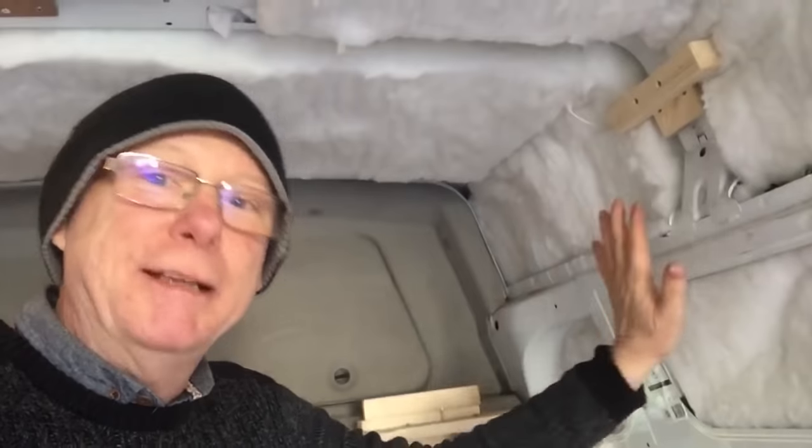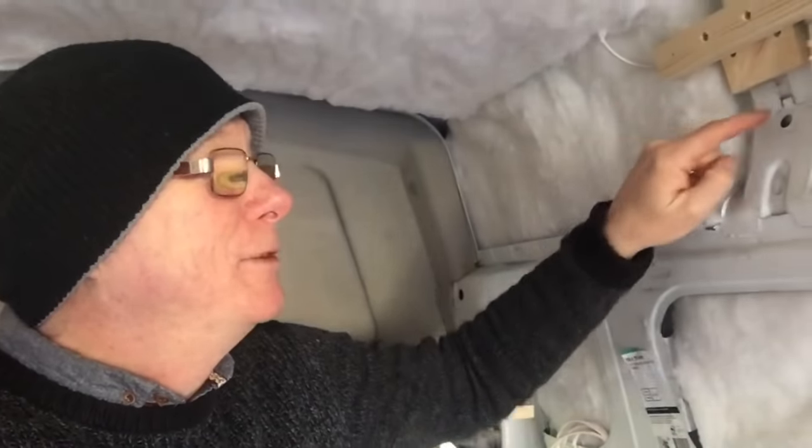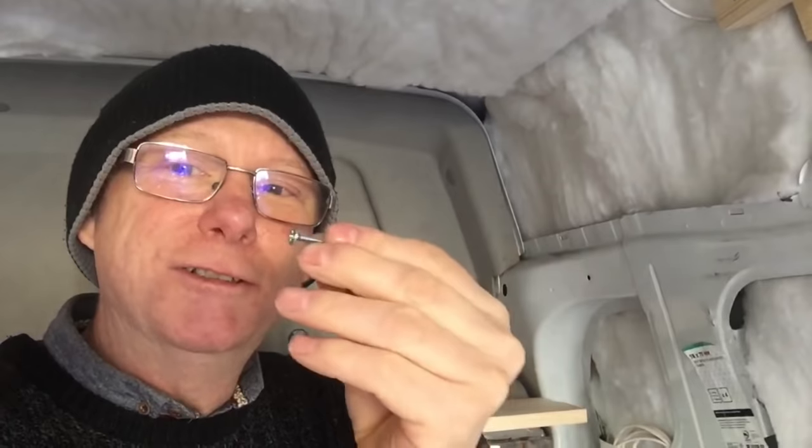Before I put the battens up, I normally put the vapor barrier up first, and then the battens go on top of that. The screws I use are these self-drilling screws — they're absolutely brilliant, they've got little drill bits on the end. The reason I use these rather than drilling a pilot hole and using normal screws is because the outer skin of the van is only about that far away on the other side of this channel. Using these screws at the right length means I know I'm not going to penetrate the outer skin.